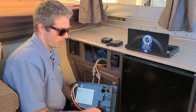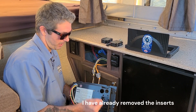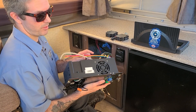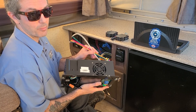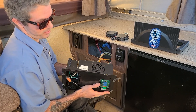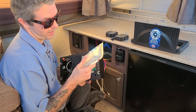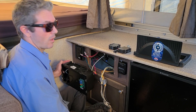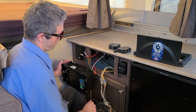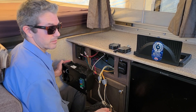With the new converter in hand, we are going to have to knock out the two areas here for the Romex to clip back in. With everything knocked out, we are going to go ahead and reinstall our 12-volt side the same way as we took it off. We are going to be using our large cap end wire connectors — these are CE5 and CE8 size. Once the 12-volt side is all buttoned up, we are going to push the Romex back through along with the chassis ground and connect the breakers.